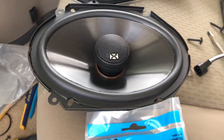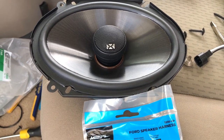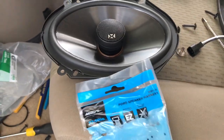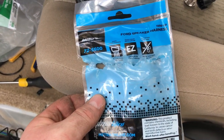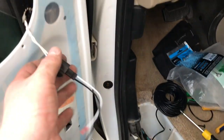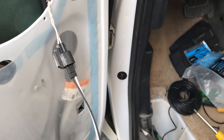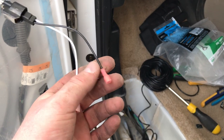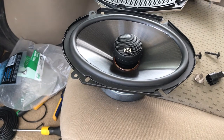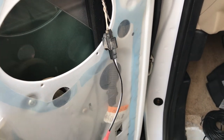There's the new speaker — these are really nice V-Series speakers, handle quite a bit of power. I'll throw a link in the description where you can find these. Also use our coupon code — you can save a little bit if you're going to order these from NVX. And our harness adapters — we're using the Metra 72-5600. What they do is they plug directly into the factory plug, they also seal, which is super nice. Black is negative, white is positive. These hook up to your new speakers. We're going to use the same screws that we used to pull the speaker out to remount the speaker back in with the new harness attached and reassembly.